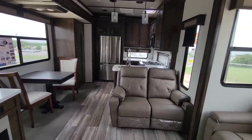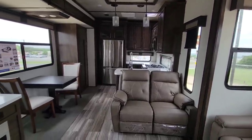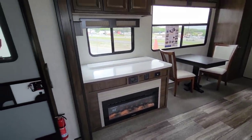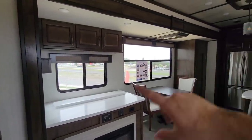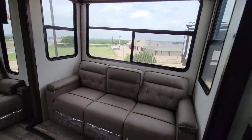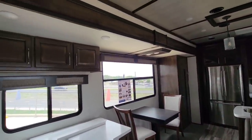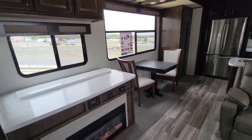So the thicker baggage doors are just one of those areas you can spend a little bit more and get something significantly nicer. As well as the tires. Spend a little bit more, put a G-rated tire on here, or even an H-rated tire, and I think you would have an absolutely fantastic setup. Put this slide on a rack and pinion slide. The rest of them can be cable driven. I'm not too concerned about that, maybe even Schwintek, but this one right here, I absolutely believe needs to be on a rack and pinion slide. It's an enormous slide and it's very deep and it's very heavy. So all things to consider.